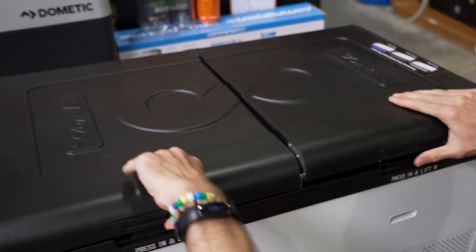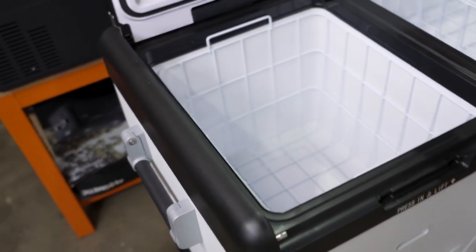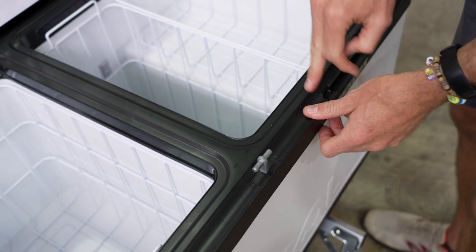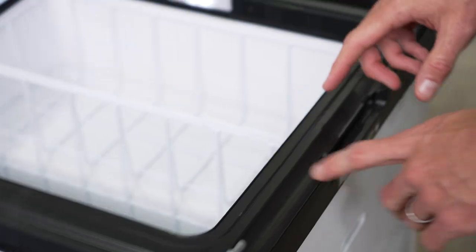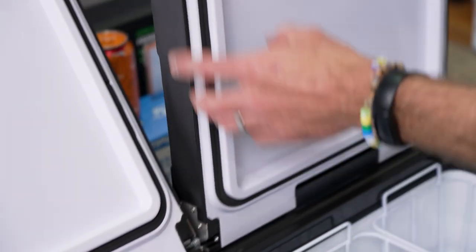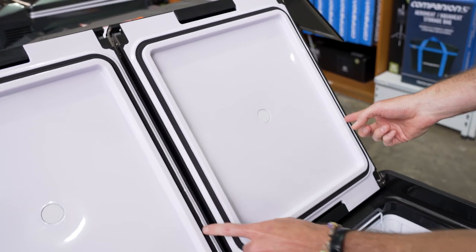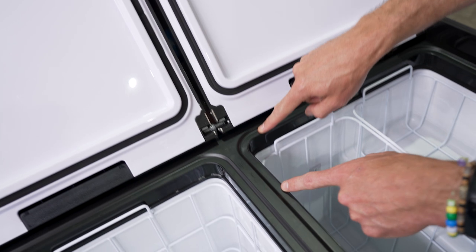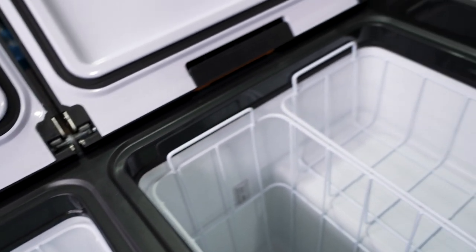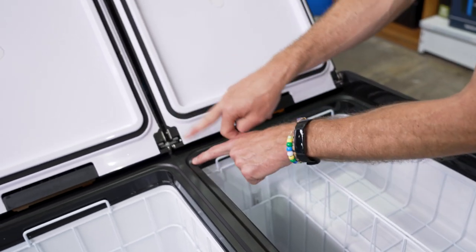Both lids are completely removable and operate the same way. Looking at the insulation thickness, you've got about six centimetres of insulation all around — commercial grade foam, really high quality tropical grade insulation. All the lid latches and components are stainless steel or metal, and the latches along the back are the same. Even the latch mechanism inside the lid is all metal componentry. Underneath the lid there is a foam seal running right around both compartments, which matches up with a little lip around the top of each compartment. There's also a small hidden heating element around that edge to stop condensation and ice build-up, ensuring you always have a good seal.